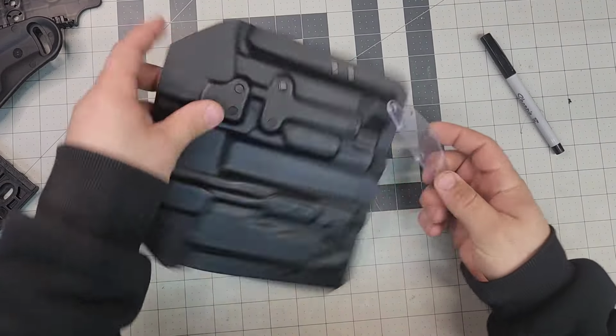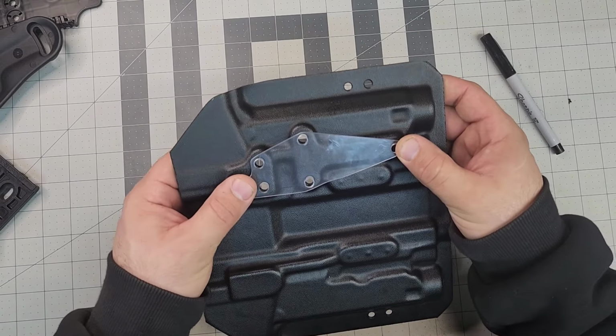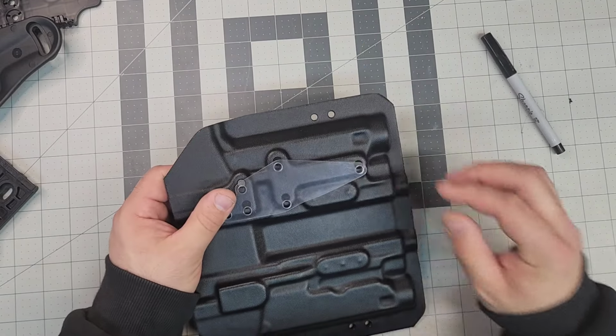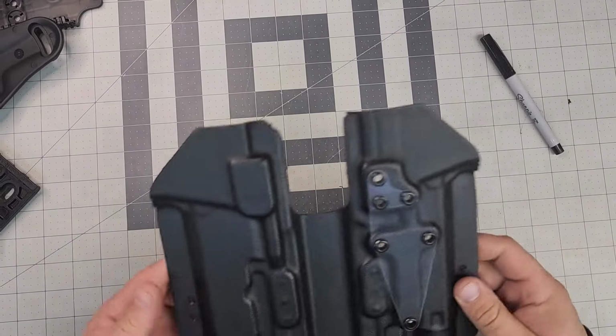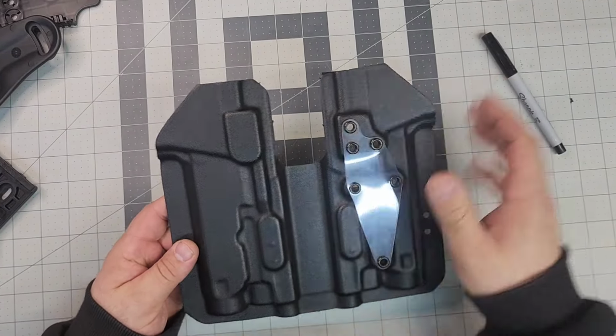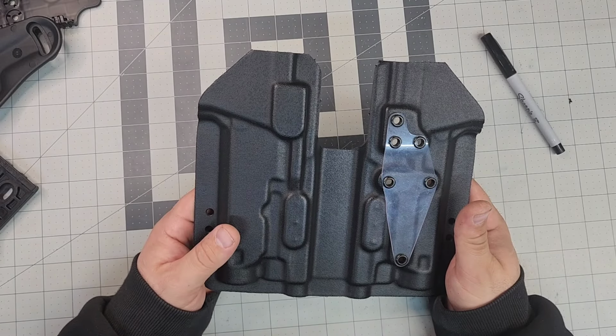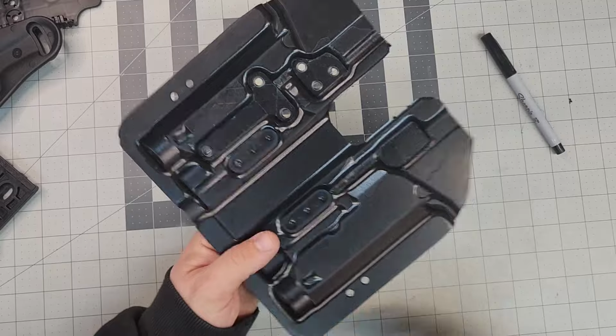And there we are right there. Just gonna line it up, and I'll just throw it in with the eyelets. Real quick, real plain, real simple, real boring. And here we are right here, and as you can tell, I cut part of the U-channel out. Reason being is because that hump up won't allow you to do a good fold on the sight channel, and it will ruin your beautiful masterpiece that you're working on.